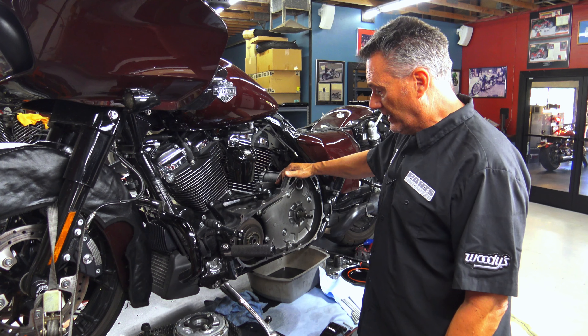So quickly before I go, let me just show you the ribbing I was talking about inside the primary of the early Fat Boy. Here's that ribbing — you see all these ribs that are built into the primary here. That's all it does — deaden sound. There's also ribbing in the primary cover, but it's all being powder coated. The very early Evos didn't have that and they were quite loud as far as the primary goes. Alright, so we're going to get the transmission out and show you what that looks like on this 09 Road King. We'll replace the bearings and whatever we need to do. Thanks for watching — I really appreciate it. Make sure you like us and subscribe on Facebook and on YouTube, and I hope you enjoy the process of rebuilding this transmission. We'll see you in part two.